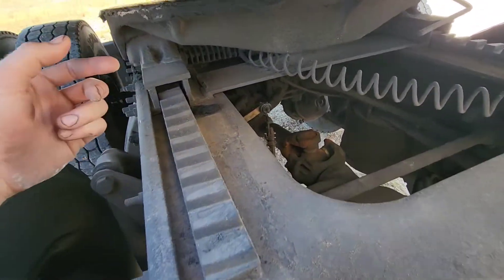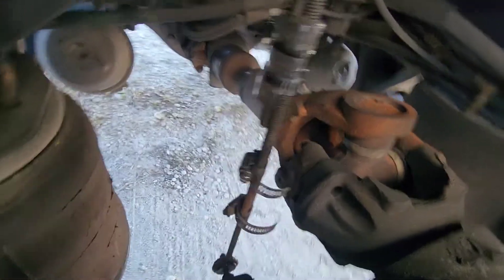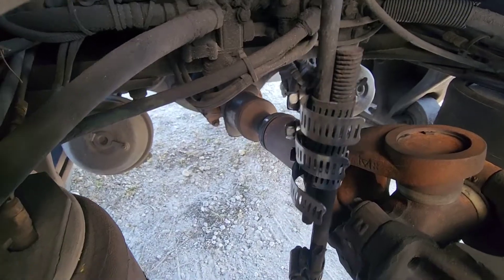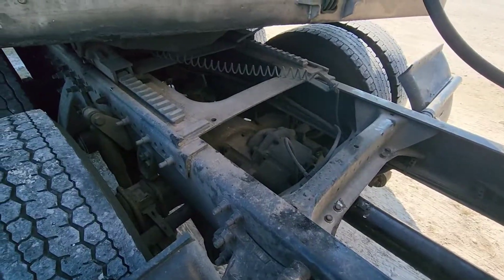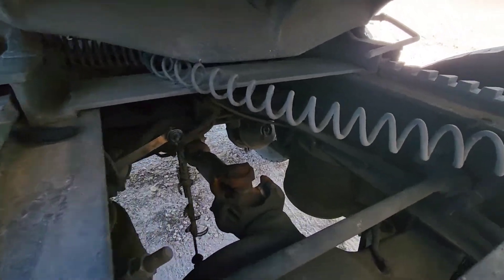Sometimes you have to raise the airbags slightly more. What I did on this truck is I cut the stock airbag height leveling stick and added a piece of metal in the middle, and put these fittings on there. You don't want to make them too tight — make them snug, don't strip them out. It's a very easy way to adjust your airbag height.